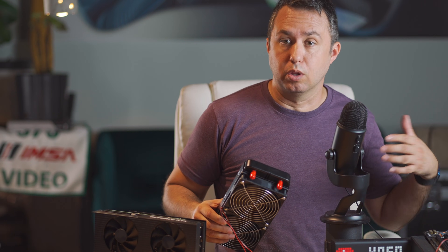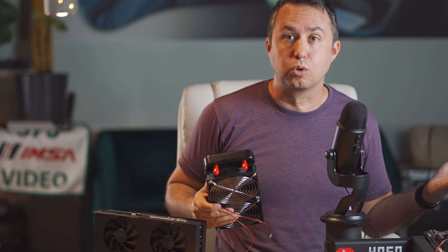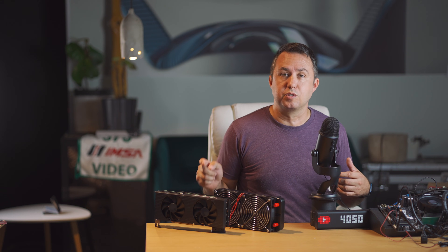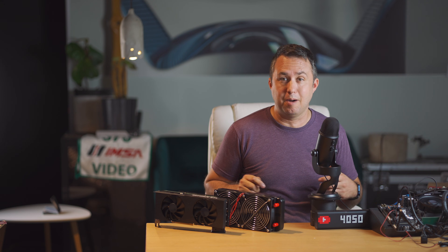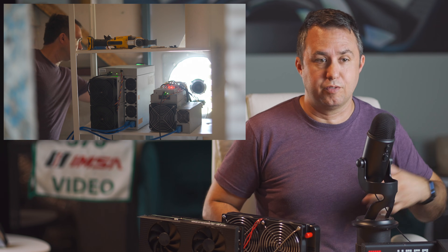This radiator will be much quieter than an air cooled graphics card though. This entire thing is a giant heatsink, so the fans can spin a lot slower and quieter. And if you've got a bigger tank, or if you're going to immersion cool a whole bunch of graphics cards, these radiators work in series as well, so you can go out of one radiator and into the next to make more cool coolant. You can always add more to the loop, or you can add more loops. I've got a bunch of ASIC miners at the warehouse that I would love to submerge in this stuff — run them silently in like a 200 gallon tank. I may need a sponsor for that size of a project though — cough cough engineeredfluids.com cough.